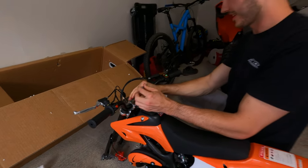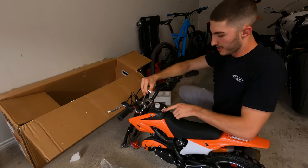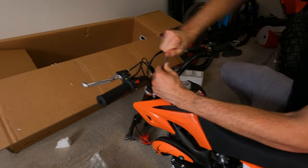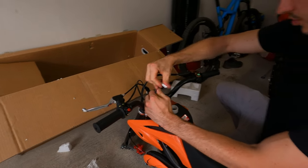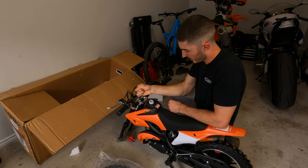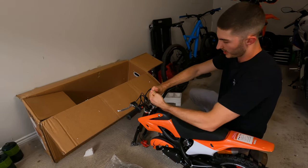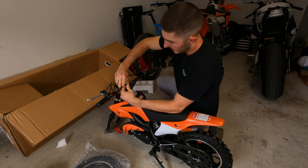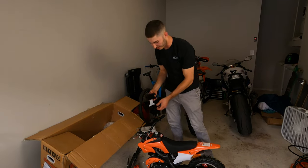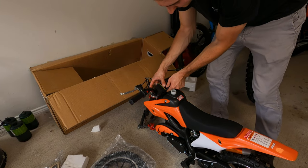I mean, you gotta remember the price tag of this bike. That's pretty absurd, it doesn't seem bad for the price tag, that's for sure. The mix ratio on it is really rich too, so that's a good sign. Keep it nice and healthy, 25-1. Like most true dirt bikes, you run like 40-1 or maybe 35, so that'll be nice and rich, be good for it. And we'll even break it in with a proper heat cycle, that way give it the best chance possible to last its whole life. It even came with the little legit bar pad. That's sick. There we go. This thing is legit.